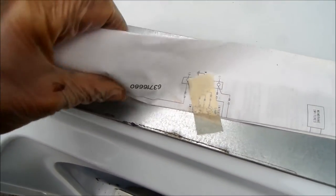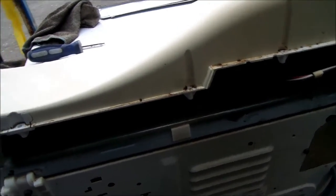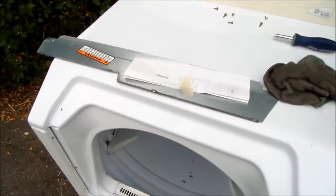We do have the tech sheet which comes in handy for troubleshooting. What I did was pull the back panel off and push all the connections in — particularly that ribbon cable that goes to the control board — and it seems to work fine. Let's pop it back together and see if it's going to work again.